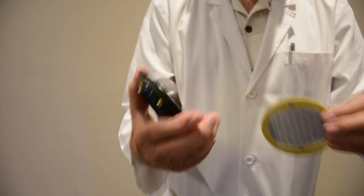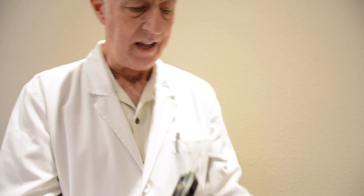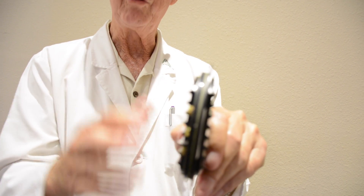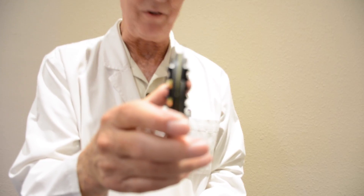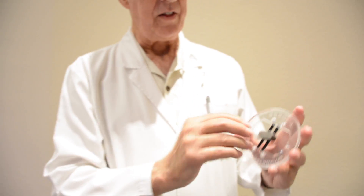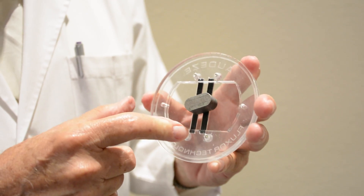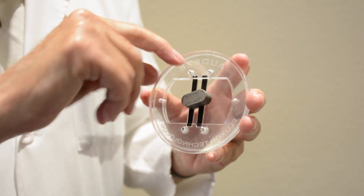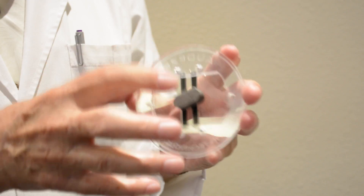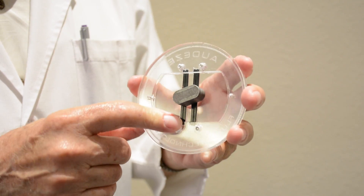In the center it actually looks like this. We have magnets on either side and then waveguides — these triangular ridges — and that helps smooth out the mid-range sound. We have a special magnetic technology that we use. All magnets have a north pole and a south pole. We found a way to take one pole and literally bend it over so it's adjacent to the other pole. That way you get almost all the magnetic energy focused on one side, so it's much more efficient — twice as efficient as conventional magnet construction.